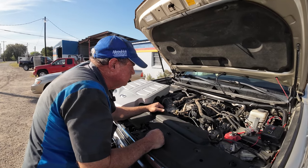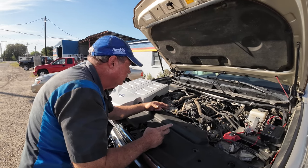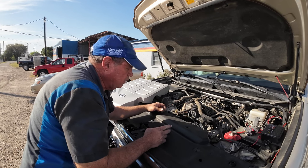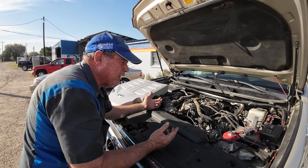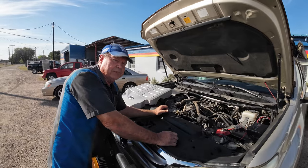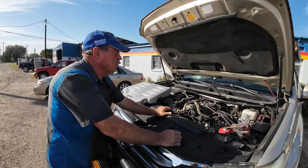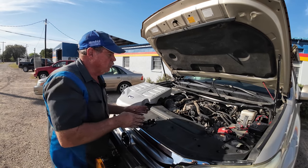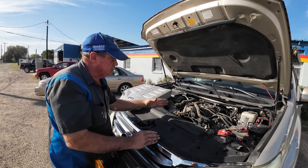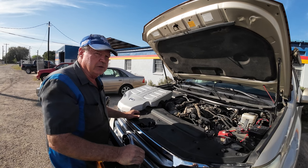The PCV valve I replaced because we were in there. The PCV hose we couldn't get, and the heater hoses we replaced both of those. The PCV plastic I would have replaced, but it's on back order. We're not going to leave a car down for four or five weeks waiting for one piece of plastic. If you know you're going to do this job, I would order all the hoses, plastics, and O-rings that go in the valley ahead of time. The actual gasket is just silicone and then you have the gasket on the intake — not a lot of parts, just a lot of time.